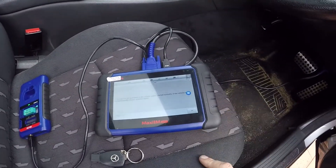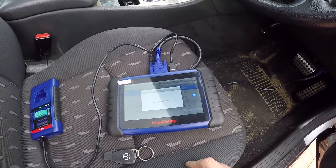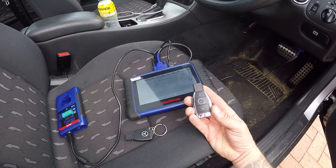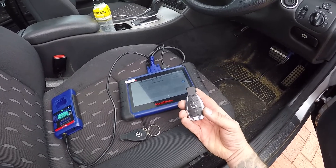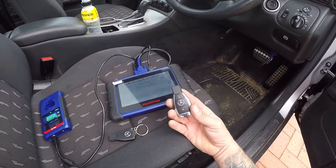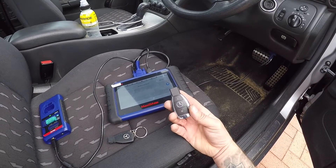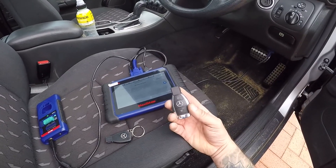Key complete - yes. Turn the ignition on - check, we've already done that. Check if remote locks - yes, we've done that. And that's it - that's your new key programmed in. Look out for the next two videos: we'll be doing all keys lost on this same car, and also with a J-Box. With these earlier Mercedes, OBD is absolutely fine and can take anywhere between 10 minutes to just over an hour depending on the key calculation. Thanks for watching, remember to subscribe to my channel and please leave any comments below.